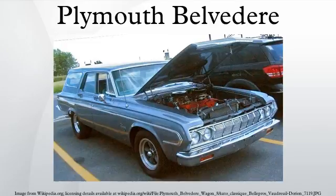The Polyspherical head was not the choice for hot rodders because of the lack of support for performance parts such as headers, cams, intake manifolds, and cylinder heads that were widely available for the 318 LA and the 340/360 engines. Hence the confusion where old car enthusiasts refer to the 1967 engine as being A-style, which is incorrect if looking at Chrysler's engine history.